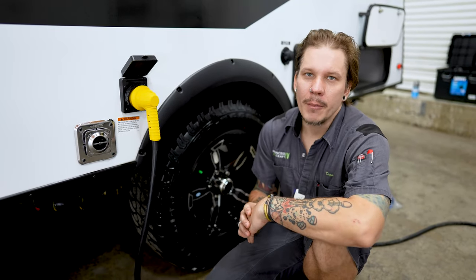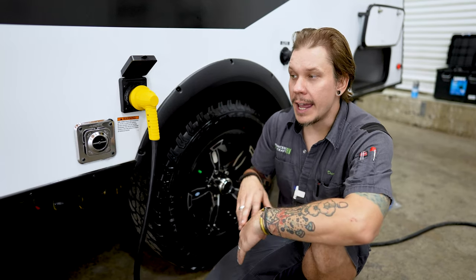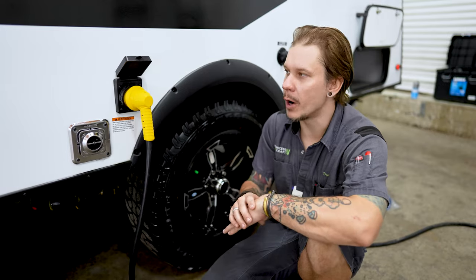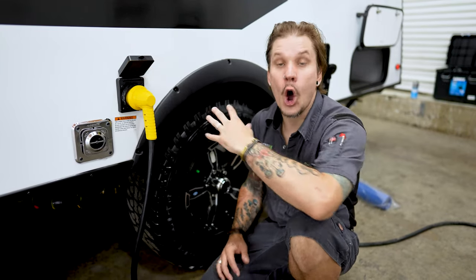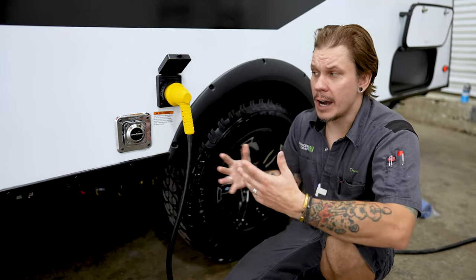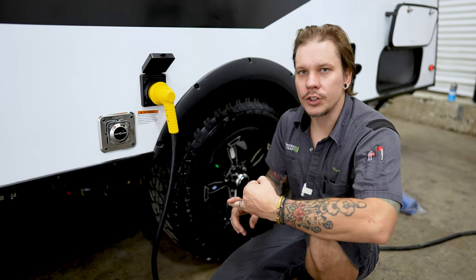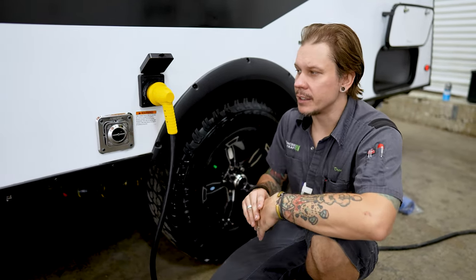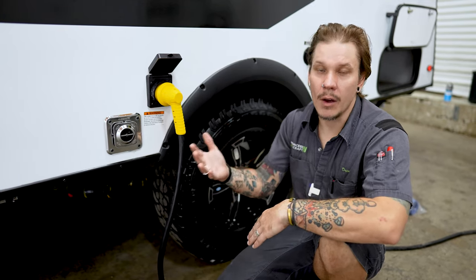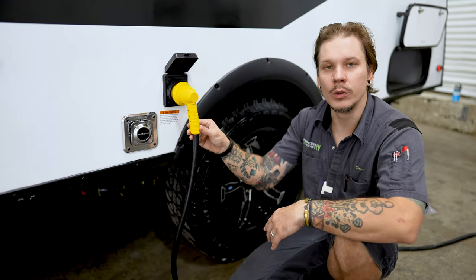For every unit that I deliver, I further recommend the addition of a 30-amp surge protector. Even with the most basic units, there's a ton of stuff going on electronically, and the only way to actively manage the power coming into the unit is going to be with a surge protector. There are a couple of styles available on the market: one that mounts on the trailer side as a hard mount option, always running in the background; and a second option that plugs in line with your power supply. Out there in the wild, you're going to find substandard wiring, environmental surges, and use-and-abuse power supplies. If you have any questions on what we recommend, feel free to give our parts department a call.